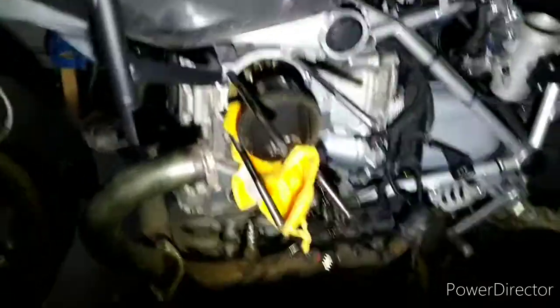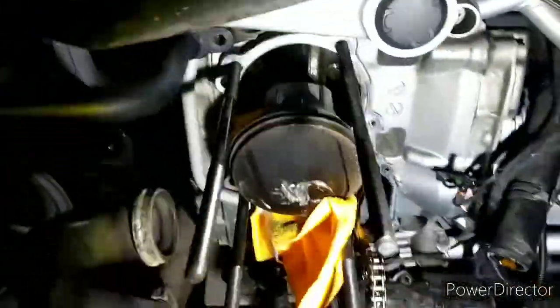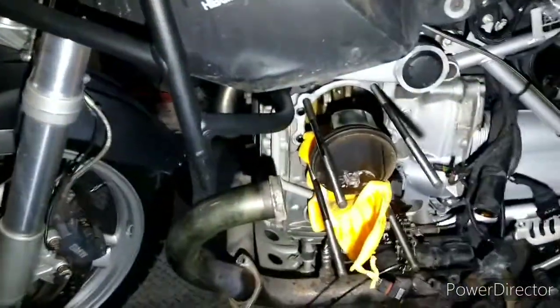A few little things for those of you who might be trying this job - I nearly got caught out by the cam chain tensioner, which is a two-part thing. This screws into the top of the cylinder casing, and then it's got a spring-loaded tensioner which goes inside that. When you remove the outer part on the left-hand side of the engine, the inner was left balancing on top of the cam chain guide. If I hadn't noticed that and had pulled off the cylinder, that inner piece would have dropped down behind there into the abyss - into that tunnel - and it would have been a nightmare.